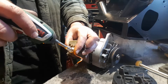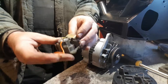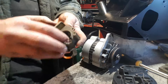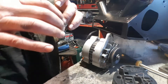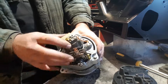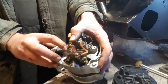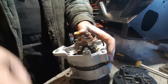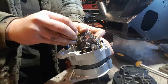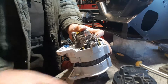I've secured the brush back onto the top of the module. Just double-check — they're both springing, they're both free, they're both moving. To reinstall back to the alternator, all I need to do is to line it up with the base plate. If I push that down, you will see it lines up on the screw holes here. Two screw holes, two bolts to secure it back in.